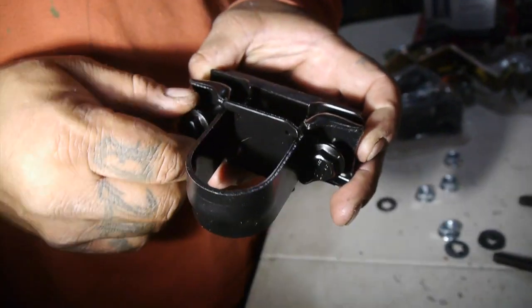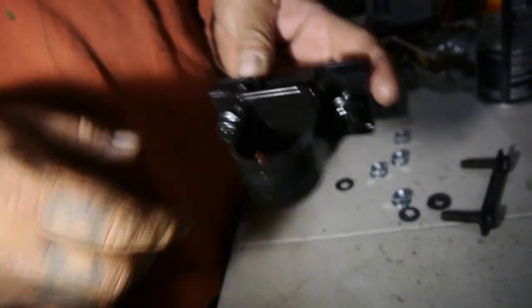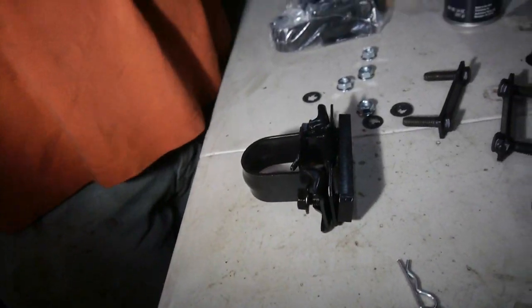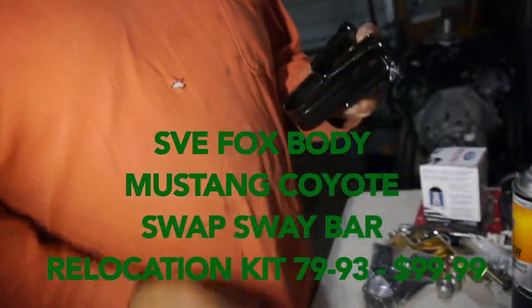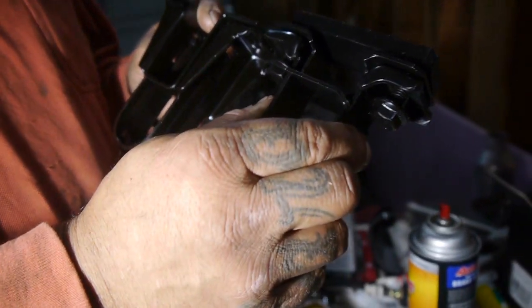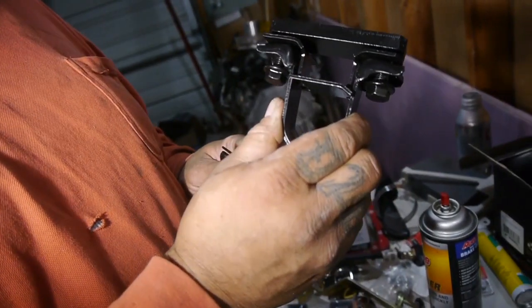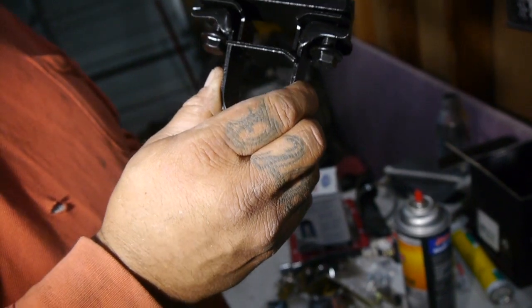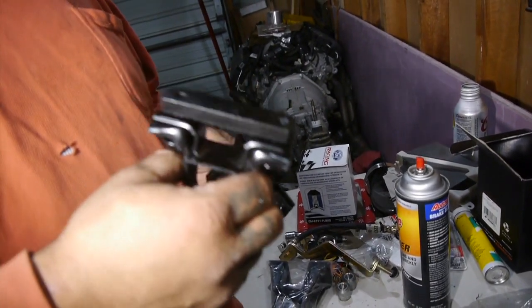This kit was about $74.99 - it's just a little bit more of an extension coming for your sway bars down to your car. I'd say it's probably for a terminator swap. Since this didn't work for us - our sway bar after we removed the oil filter was still smacking our alternator and AC compressor - we went back online and found that LMR has a coyote swap set. As you can see it has a much deeper drop, which is definitely what we need.